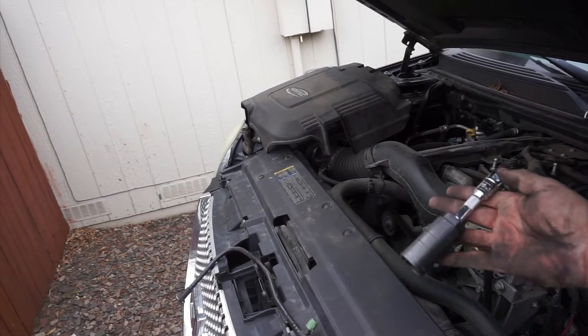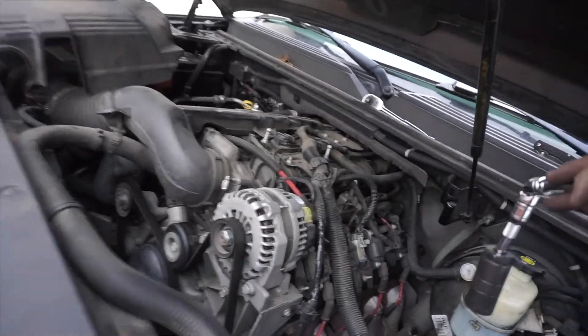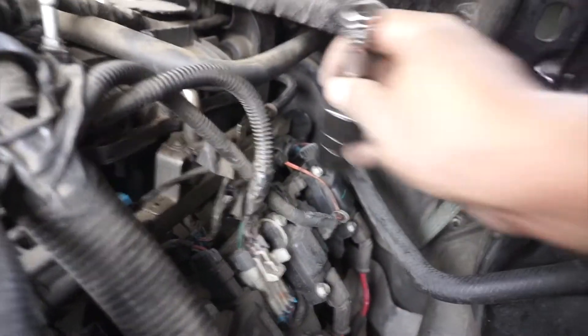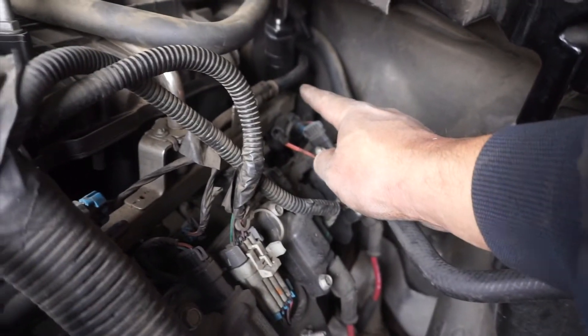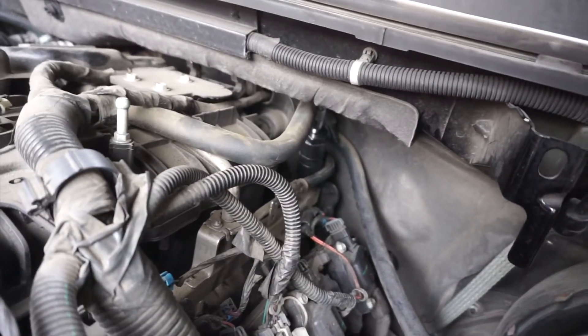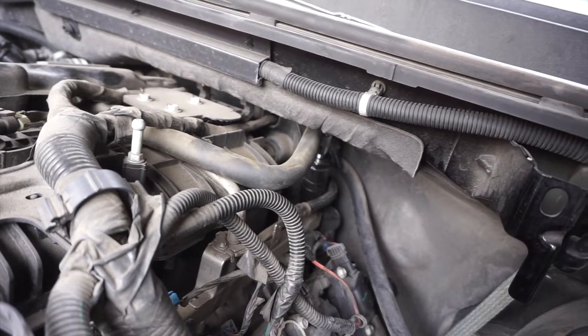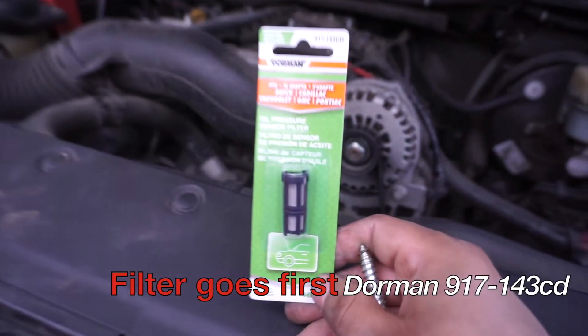To get it loose I use the oil sending socket followed by a 3-inch extension, followed by a swivel, followed by a 6-inch extension. Put it in there fully together. My advice is to go and put the socket between this fuel line — go inside that fuel line. If you don't go inside that fuel line it won't let you correctly push it on the sensor because it's at an angle. If you go in exactly inside that line it'll help you get in there straight, right on top of it. It's super easy — definitely do it this way so you don't spend a lot of money taking off the intake manifold, buying gaskets, or possibly having leaking fuel.